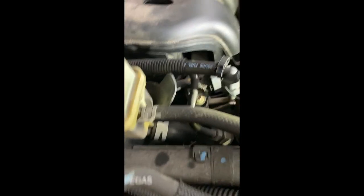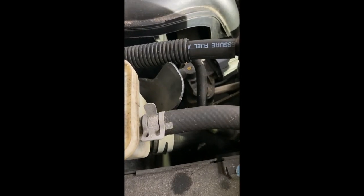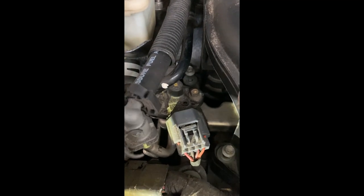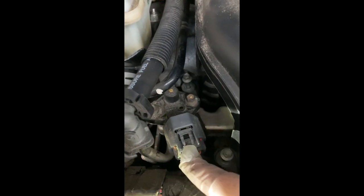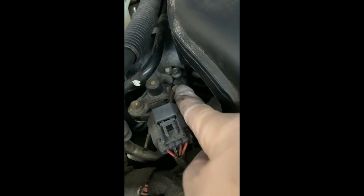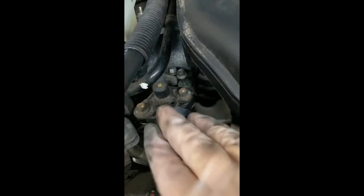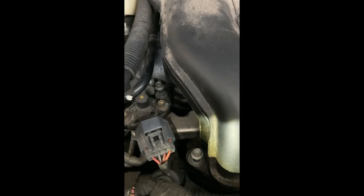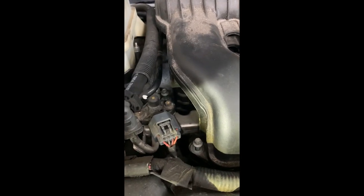Okay, there should be a clip back here. And if it's like the other ones, you just push the clip in and pull up. Should be able to come out. And if I cannot maneuver this to the side and up, then I will disconnect this solenoid here, take out these two bolts, and take out the rubber hose that goes to the back of the solenoid. And that way, this whole area will be cleared, and I'll be able to remove this. But some people don't do it. They just take this out, and they just maneuver it out, right?